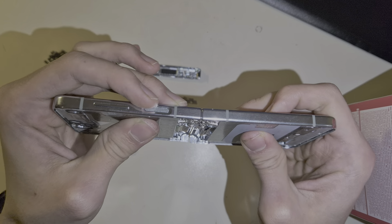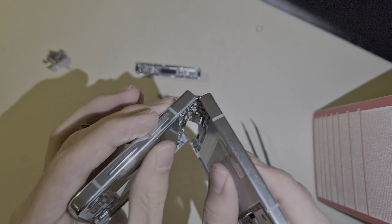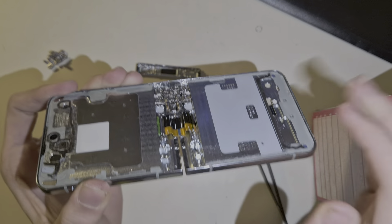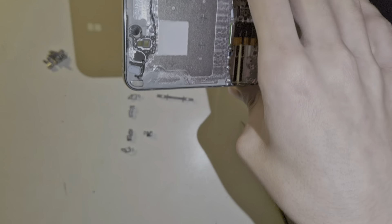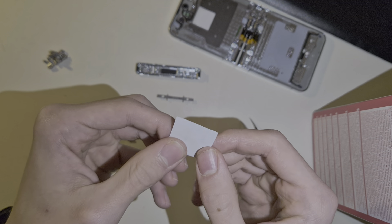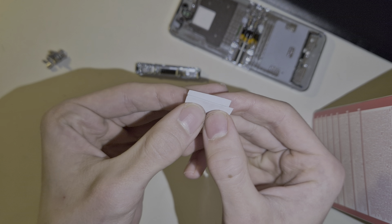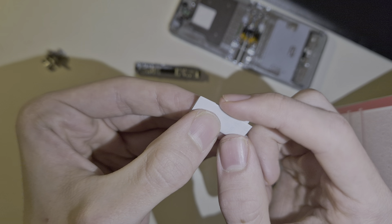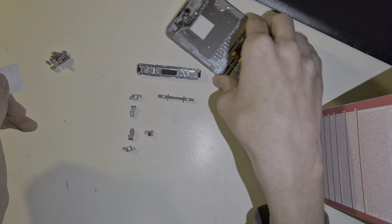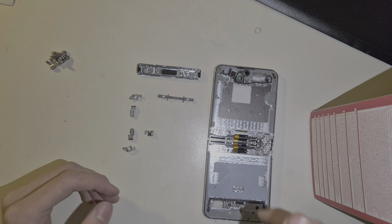You can see, now it's flat, and the entire hinge design basically recesses down. So, for example, if you'd have two layers of paper and fold it, you can see that the inner layer actually kind of moves out — there's a small lip. Since the screen is fixed on the top and bottom of the phone, there's only one way it can move without breaking, which is down into the hinge.